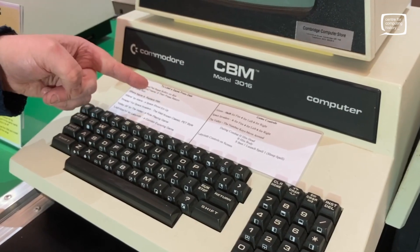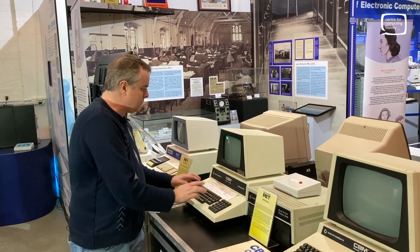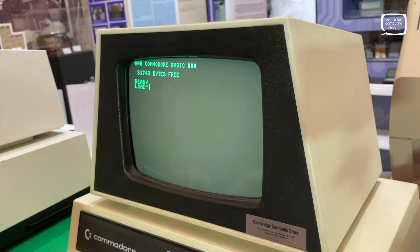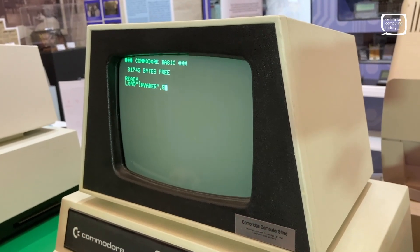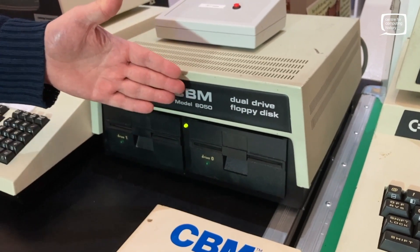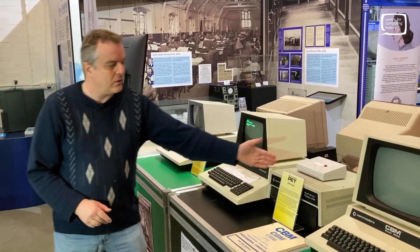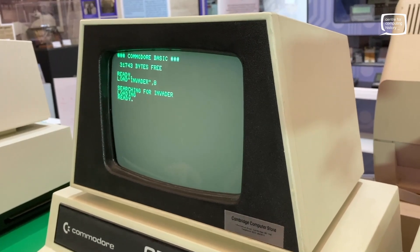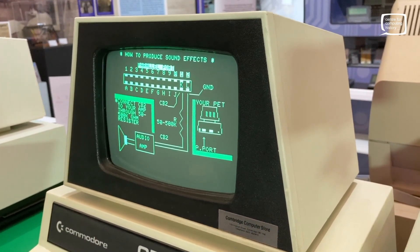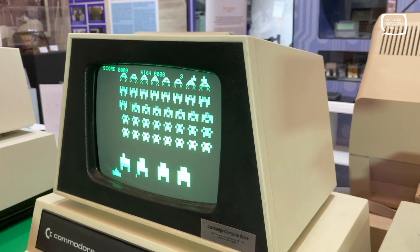This is the main part — what you'll be able to do here is literally operate a PET as you would have done back in the 1970s. We've got instructions on here, so let's try and load something very quickly. I hold shift down for inverted commas when it's got its own key. Invader, comma, 8 — because we're loading from a disk drive — and here's its beautiful big disk drive, the model 8050. It's searching for Invader, there's a lovely little buzz from the disk drive, and it has loaded. We can now run the program.